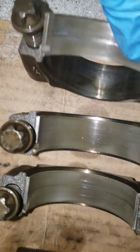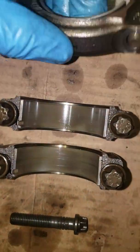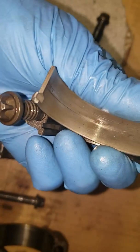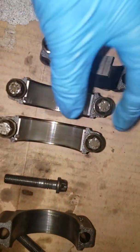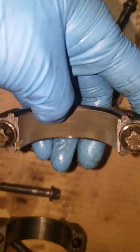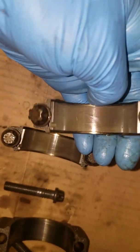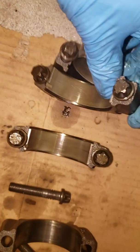This is two. This bearing and cap doesn't look too bad. There's a gouge in the middle there — might be some foreign debris that dragged to the middle of the bearing, but otherwise this bearing is pretty good. I don't know why every engine I've torn down all the bearings have been discolored like this. Probably just from age. There's nothing in this bearing that you can catch a fingernail in. There's some streaks through it like it dragged some dirt through this journal, but nothing crazy.